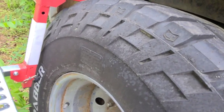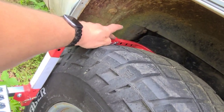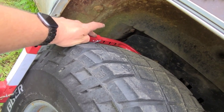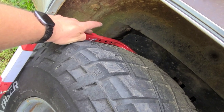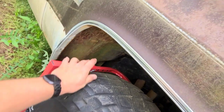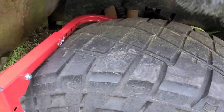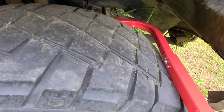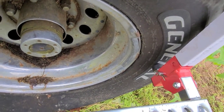I adjusted the holes and it didn't take that much. I pulled my pins and slid it out to the fourth hole. On my truck I think I was in the third hole with the 20s, and I just did both sides like that — to the fourth hole — and then I screwed the little rubber snubbers all the way in.